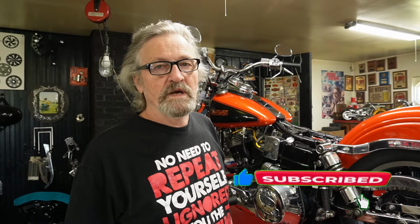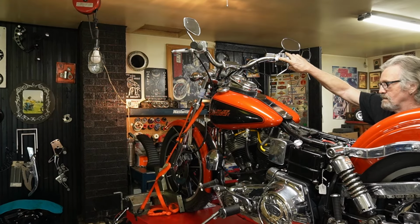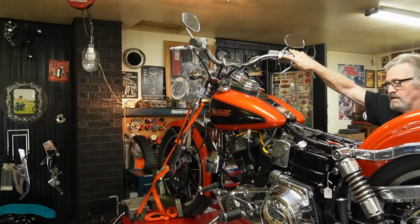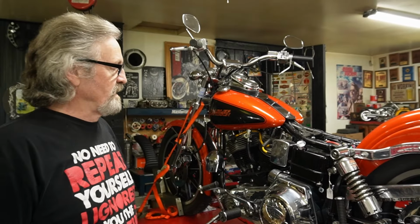I don't think I put a new Bendix in it. I may not have, but in any case, it's just kicking out. I try to start the bike and it goes ring, ring, and I'll show you. So it's definitely the Bendix drive misbehaving in there.